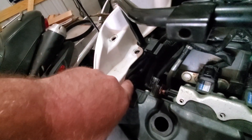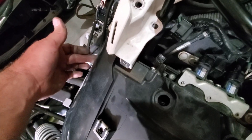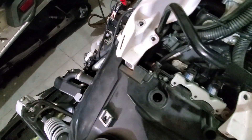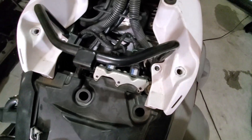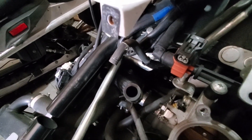Then under here you have a rubber hose, and then right here straight underneath there's a large rubber hose that's about three quarters of an inch — you'll want to release that as well. You can kind of lift this up and reach under there to get to it. Then lastly, you'll want to remove this screw right here and this screw right here — that'll just give you a little bit of wiggle room. Then if you grab right here, you can just lift up and slide this whole unit forward. You'll see right there, that's the large rubber hose, and then you have a smaller rubber hose up here that you have to release.